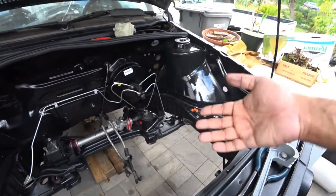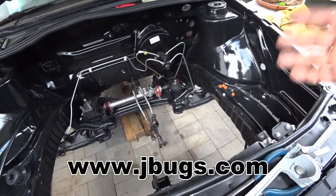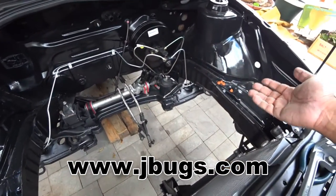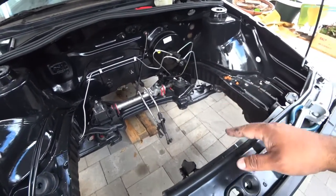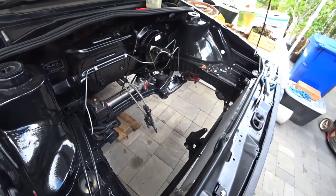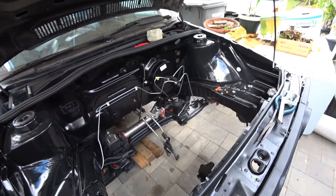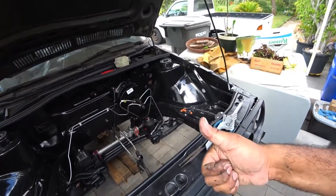If you're lucky enough to pull all your bad lines off, copy them as much as you can. The website I'm using to get all my lines is JBugs — they sell air-cooled stuff, but they have a whole section of just brake lines that you can buy to length, already with all the fittings and everything you need. You're looking at about five to ten bucks a line — dirt cheap. So JBugs.com is where you want to order all your brake lines. I also bought little grommets so they don't rub on the chassis and destroy the line. Follow that procedure and you'll have a really nice set of brake lines. Thanks again for watching this episode of Benchel's Garage. I'm Benchel, and as always, we're going to break, fix, and repeat. Thanks for watching — peace out.